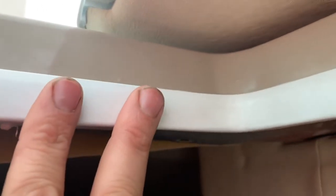Some tricky things I found along the way: the order in which you add the blocks. I wanted to drill the first two into one that was already there so I could get some alignment and know what angle the door needed to be at — forward and backward — for the next one. I put those two in temporarily while I drilled the other one next to it and screwed that in. I just slid the door over, pulled the one out with the crappy holes, moved it over, drilled new holes, and put those back. I worked my way to the right: slide the door, get alignment, drill the hole, put the screw in, slide over, get the block aligned.